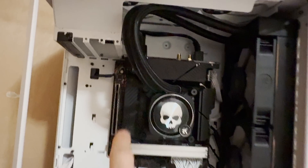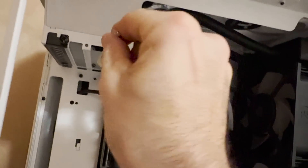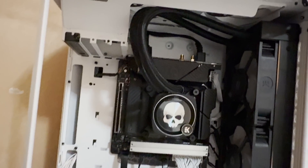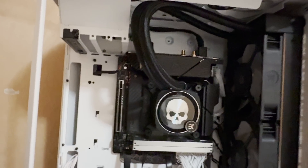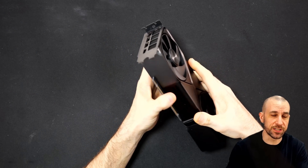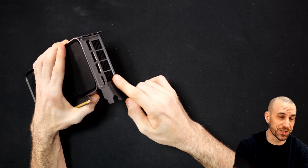If we go to the upstairs test bench, you can see how I fixed it — I just took a pair of tin snips and cut the support bracket off. When you put the 5070 in, it has full exhaust. That alone dropped the temperatures by about seven or eight Celsius. A lot of cases have these removable, a lot don't. If you don't, you can just tin snip it — it doesn't affect rigidity. So if you get a 5070 Founders Edition, after you install it, make sure nothing is blocking the exhaust ports. It makes a big difference.